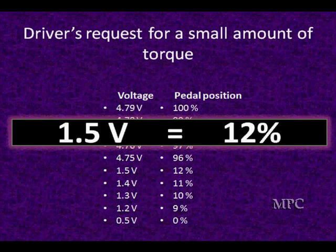The computer says okay, that's 12%. At this point the computer is going to say: I have a 12% request — what power level is that? Is that the same kind of mass airflow I've been expecting to see? Is that the same kind of RPM? Do all the fuel control and other sensors look normal? Does vehicle speed look like what it should be with the transmission in this particular gear? Does everything look rational?